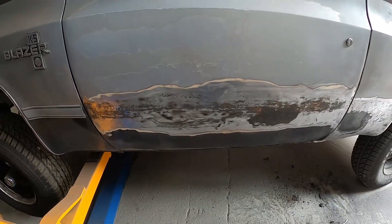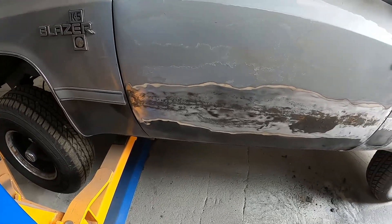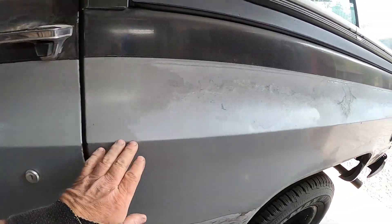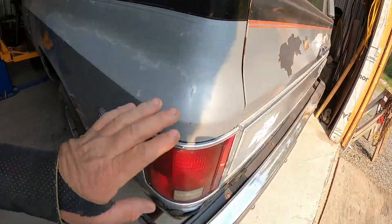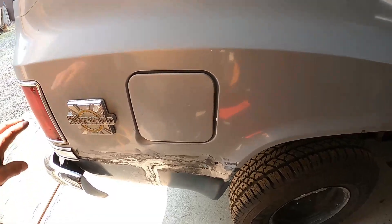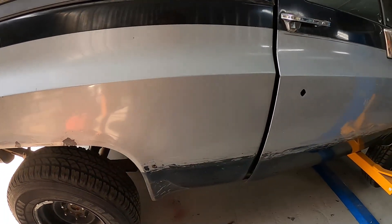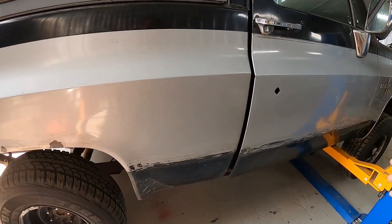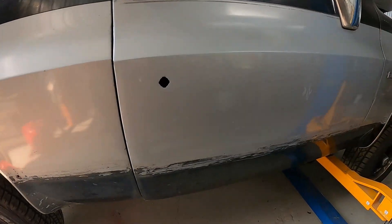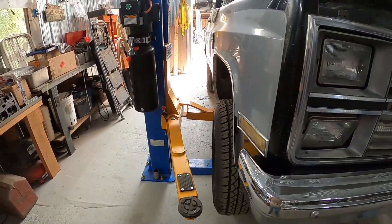Here's another piece of plastic stick-on trim that I gotta get cleaned off. What I'm gonna do is take it from this line right here and basically strip this off - probably do the whole back, take off the Chevy trim there and come all the way around. Then go from here down with black primer after I get the welds finish cleaning up, get the filler on those, get everything looking good, then primer from here down all the way around.